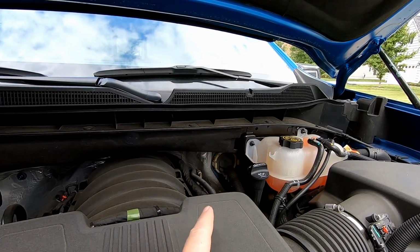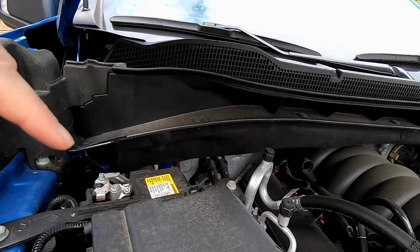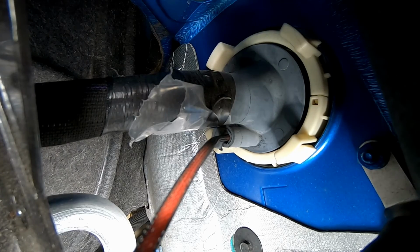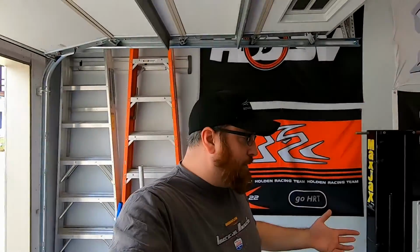So with the 22.5, they're telling us to run a cable from the battery cable up here. On the very bottom of this connector, there's supposedly a service port. Well, you could run it through there, but I almost don't see the point because I already have a wire going through that harness, and that is the power supply for the subwoofer. So yeah, that is one wiring difference I noticed from the previous installs to the newer truck installs. So just a couple pointers before we get started.